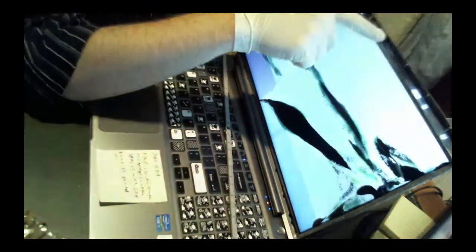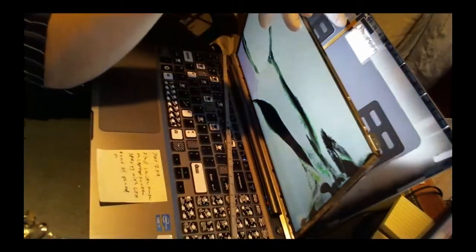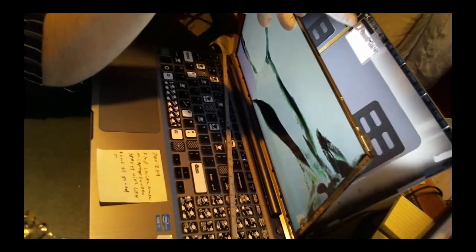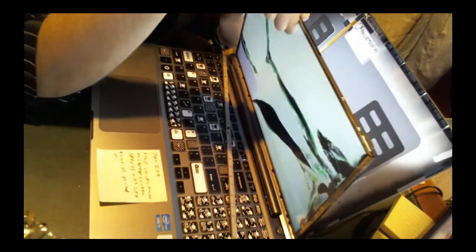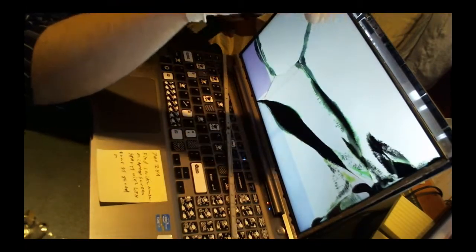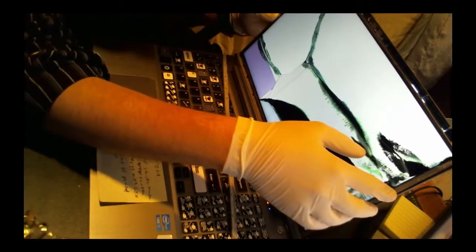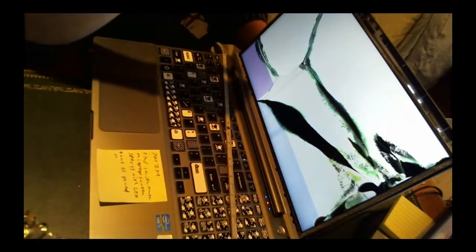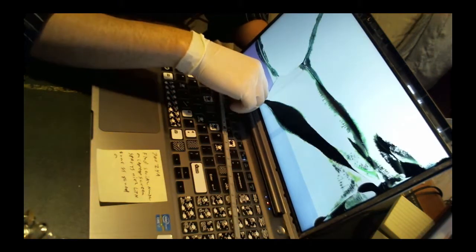Yeah, I've got to be careful up here though. The camera for the laptop screen is up here, and the wire runs right down through the back of the screen and connects right up there. So once you get there with a knife, you've got to be careful to avoid that and pop it off. The outside perimeter of the screen is really delicate, so make sure you slowly get that outer protective thin stainless steel cover off, or else you'll break it, as the other videos describe.